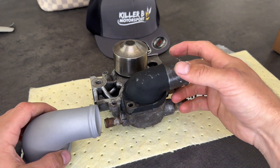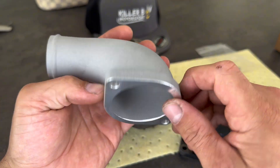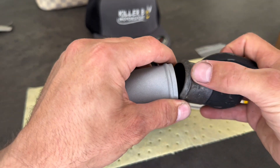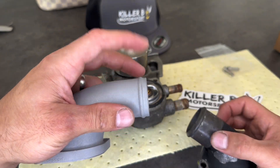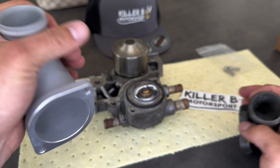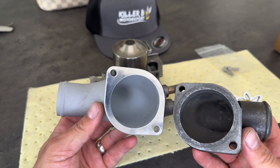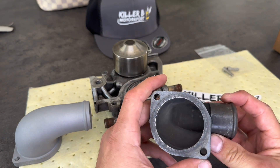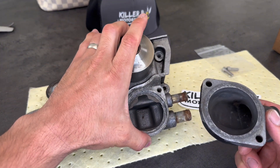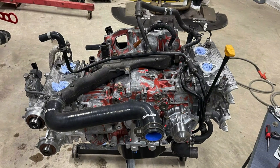What's the benefit over the stock item? This is the OEM cast piece — they're both cast alloy. The Killer Bee one has a logo engraved in there. The pipe's the same diameter on that side, and it's got that little beveled edge to retain your silicone or rubber hose with your jubilee clip. But inside, look at the restriction inside the actual OEM pipe. Water comes through this direction and then into the water pump through the thermostat.